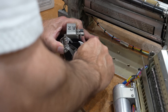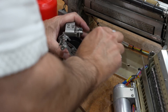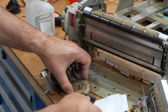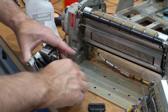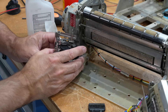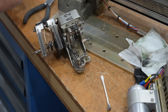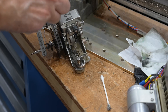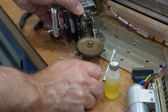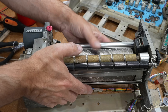This is pretty majorly caked in. Isopropanol didn't do it — maybe acetone will? Yeah, acetone does it. There shouldn't have been any grease in there at all. The grease problem continued all the way down, so I took it all apart. I'm going to do light oil instead of grease. Now she purrs! It freed it up.